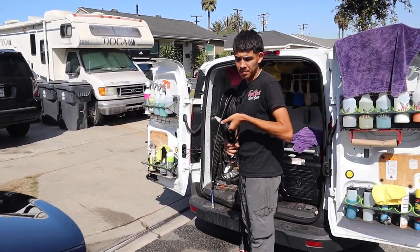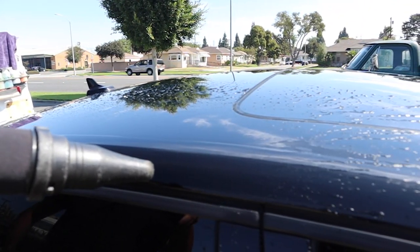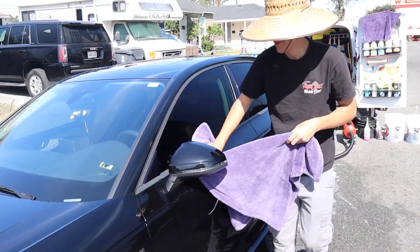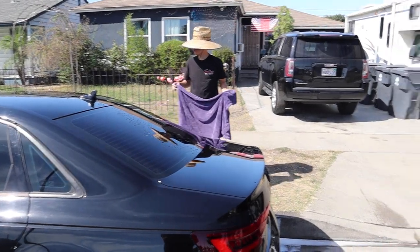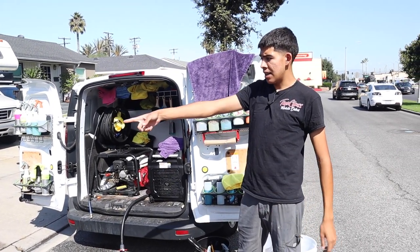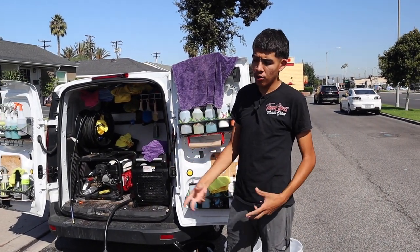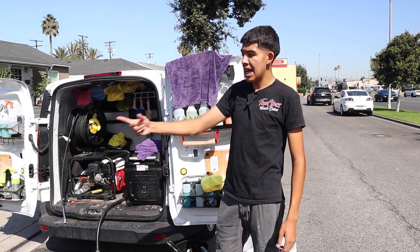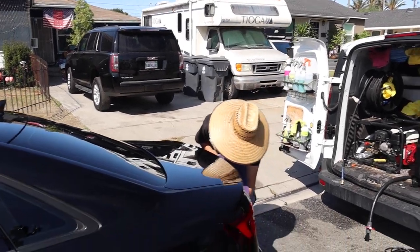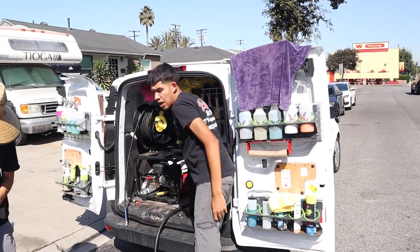All right James, your drying process — you hit it with the air blower first? Yes sir. And then have Michael follow with the chamois towel? Yeah, so I'll have him follow up with our purple drying towels. I'm going for getting off the majority of the water, plus whatever is in the cracks and crevices of the side mirrors and things like that. He'll come follow up with a thick drying towel that won't scratch and will pick up all the water in a simple pass. With only four towels, using the blower means the towels don't get super wet or dirty throughout the day.